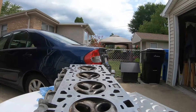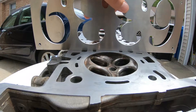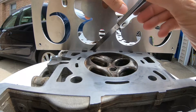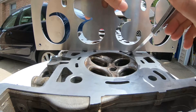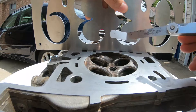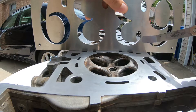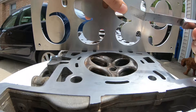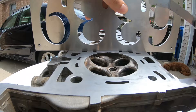What you want to do is place the material nice and flat, then take your feeler gauge and try to run it under this metal. If there is warpage, your thin small feeler gauge will be able to slide through. There are allowable tolerances you can get away with, but you have to measure the head and then do the same thing on the short block.